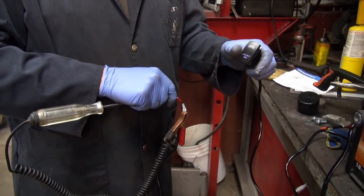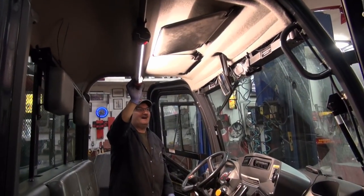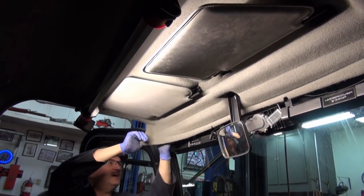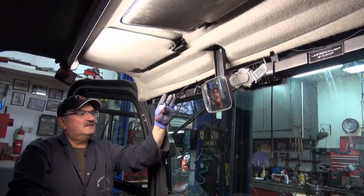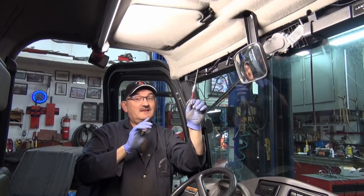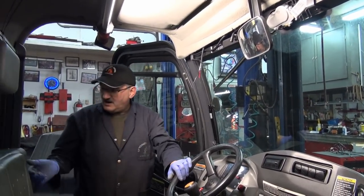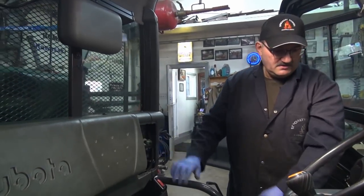So now we just go ahead and do the install in the tractor. We're going to use an LED light. Where is my light from my light bar? There it is. Negative is black, positive is white — because sometimes with other companies LEDs have different polarities. So make sure — in this case it's written right on it — make sure you read the label. As a matter of fact, read everything before you even try to install these things. Our electrical system on this is all back here, so I've got a bit of stuff I have to remove to get at it.